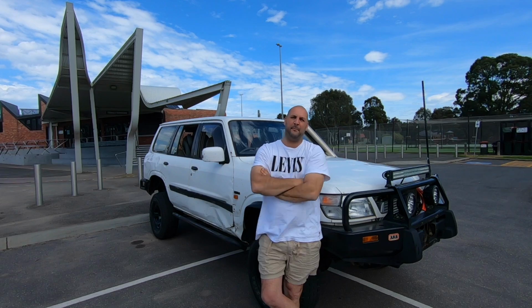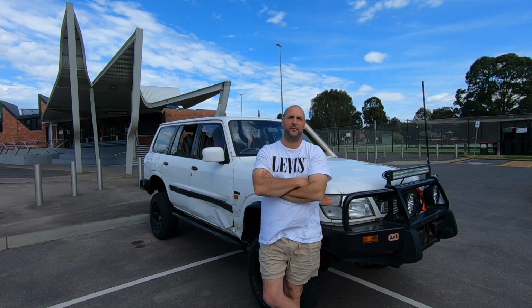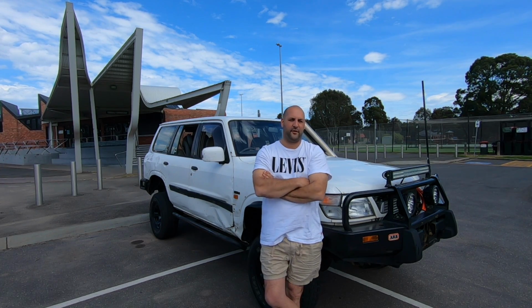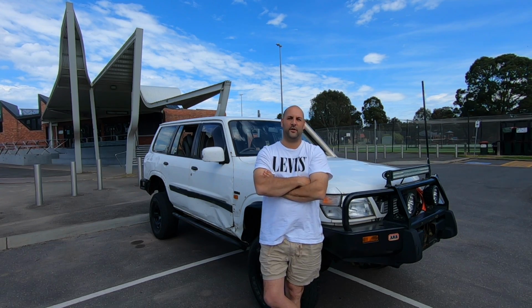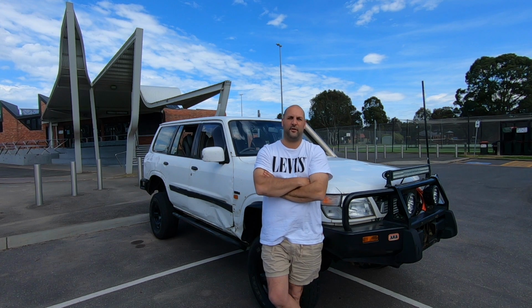Basically running a Warn high mount. Just had the standard run of the mill 4.6 I think horsepower motor on it. It needed a bit of a birthday, so obviously sent it off for a bit of work, so when it's coming back it will be a twin ox motors on it with Hurricane gear sets and a couple of other goodies on it as well, 24 volt with obviously 2 batteries in the back as well.